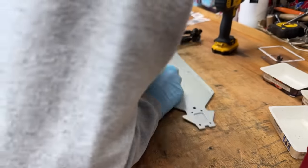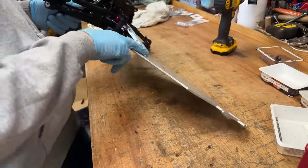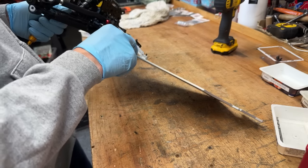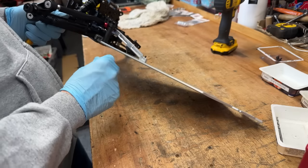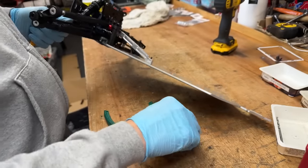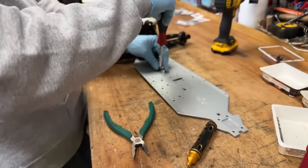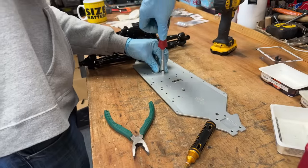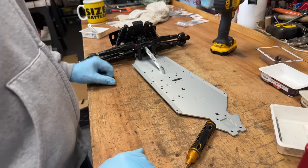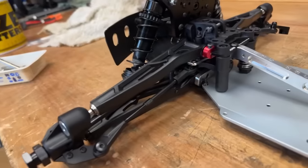Right, that in there. The nut on top of there. I like to leave this nut here always longer, the bolt, because sometimes when you bash really hard, you snap this off the chassis, and if you snap that off flush, it's really difficult to get out. If you've got it long like that, when it's snapped off, at least you can get that on there and unwind it. I didn't bother with any Loctite on there for that reason as well, so it's easy to get it out. It's got a nut on top anyway, so you can crank that down like that. Boom! Right, that is phase one done, and probably the trickiest part of all of it. It should get easier now.